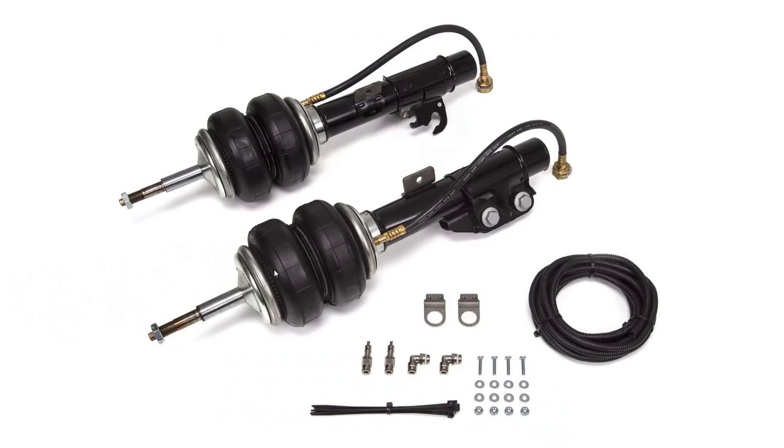Let's start off by looking at some convoluted air springs that are mounted on struts. What determines the stiffness of the air spring? It's partly the design of the air spring, but most importantly, it's the volume of air contained within the spring. The greater the volume of air contained within the spring, if everything else remains equal, the softer the spring rate.